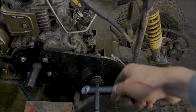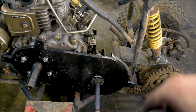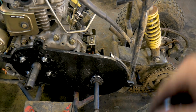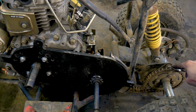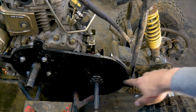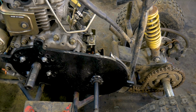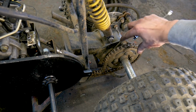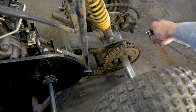Well, guys, I got the torque converter plate on there, and that was kind of my biggest worry, seeing if that could fit. I did have to cut a few things back there, but I think it is gonna do just fine. Unfortunately, the next thing is I have to line up the chain with this sprocket here, and they're about 4 inches off. So I don't know if I can just add some spacers right here and just move the whole sprocket over, but I don't know.